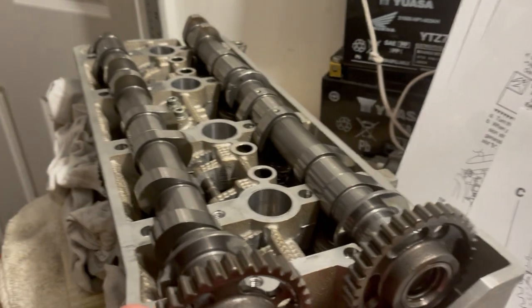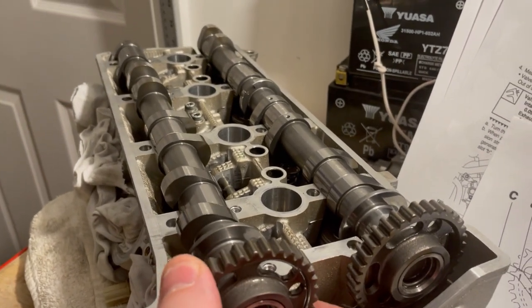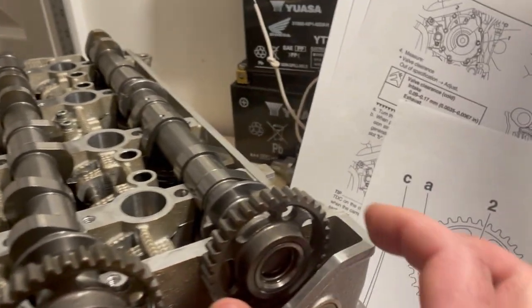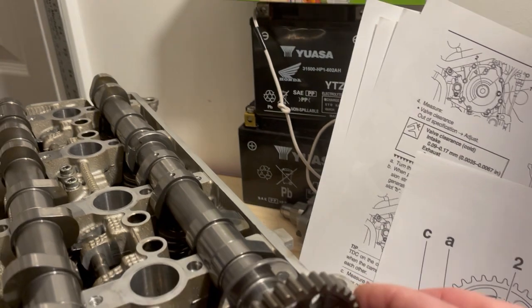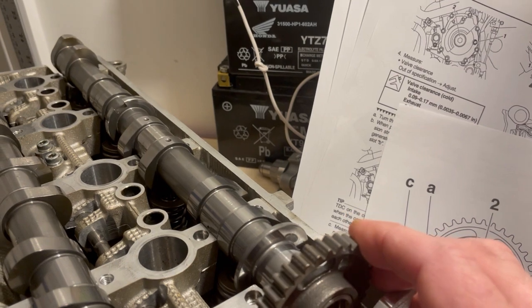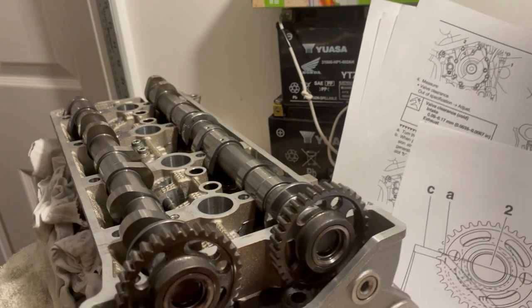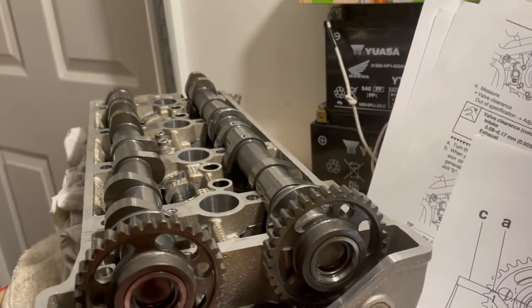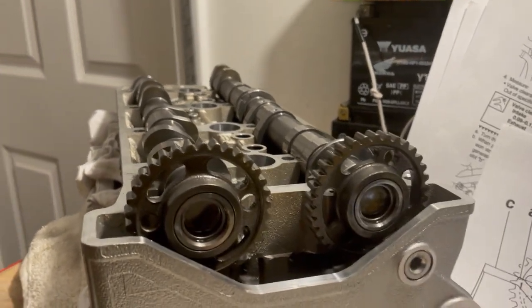When it's at K you can see the intake cam isn't actually pushing on any of the valve springs. The exhaust cam when it's at K is pushing a little bit on cylinder two and it's just coming off cylinder three — cylinder two does have some pressure on that cam. But this is the least amount of pressure across the cams when it's at mark K, which is 105 degrees before top dead center.